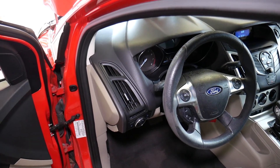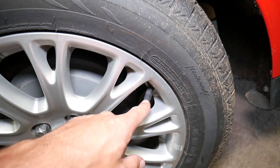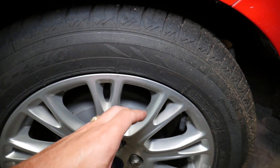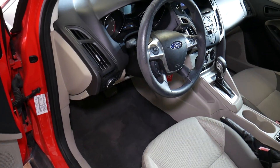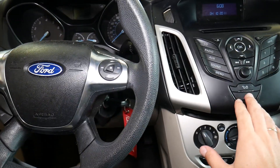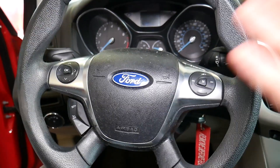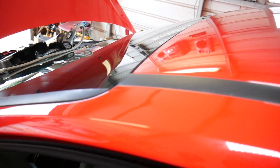Drive it for at least 30 minutes. If that doesn't fix the problem, you may need to re-learn the TPMS sensors — sometimes they get confused. To re-learn them, you put 40 PSI in your tires, but first inspect your tires to make sure they're not old or cracked, because 40 PSI is pretty high. There is a special procedure — we have a video on the channel. You turn the ignition on, pump the button a certain number of times, and it activates the re-learn procedure; then you start deflating the tires until it's re-learned.